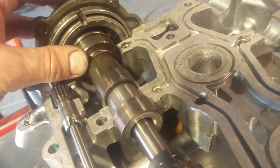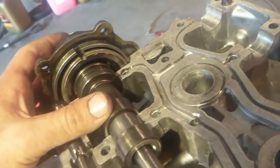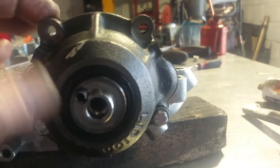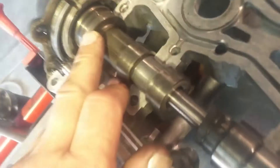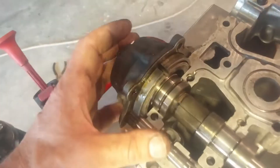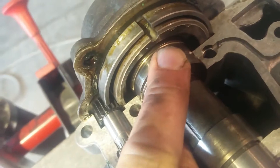If you read RAVE — the Rover technical information — there's a special clamp that holds the cam into the advance unit. When you take these off, the whole cam carrier: leave the two bolts in the advance unit here because it holds it to the cam carrier. Loosen them a bit so the gasket will come off as you take it off. Give it a quick pull side to side. That's what you do — leave those bolts in. This is what you get when you've got it off. If these come off and you think you've destroyed it, don't worry — it's dead easy to put back together. Tilt it on its end, you'll see how the holes and the cam line up, and you can alter where it locates.